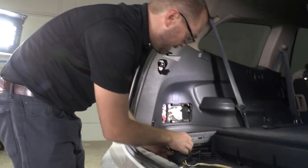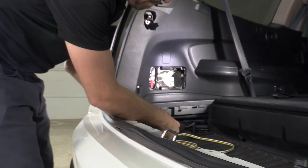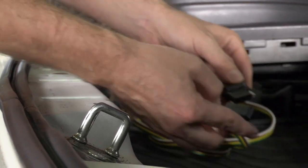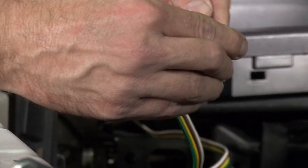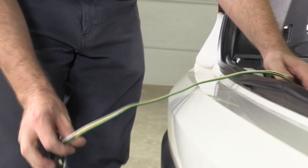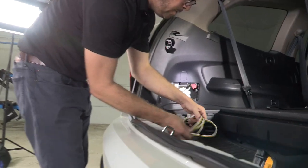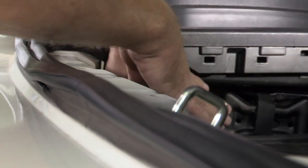With our ground wire connection made, our fuse in place, and our harness installed, we're going to take this adapter box and tuck it back here out of the way behind our jack. We have our four-way lead — I'm going to put this dust cover on to keep the four-way flat lead nice and clean. When towing a trailer, simply take the lead out through the hatch and close it to connect to the trailer. When not in use, coil the lead up and stow it here in the jack compartment, safe and out of the way from cargo.